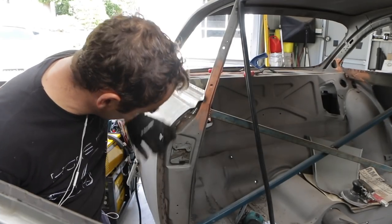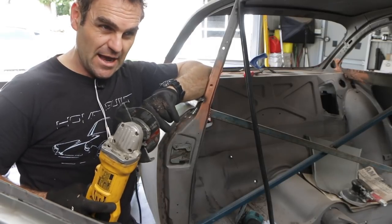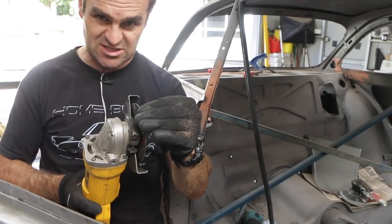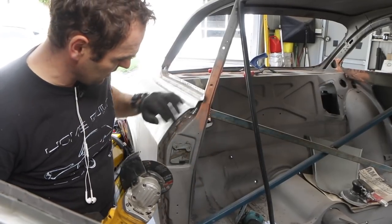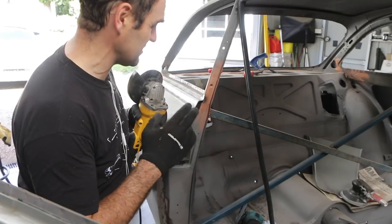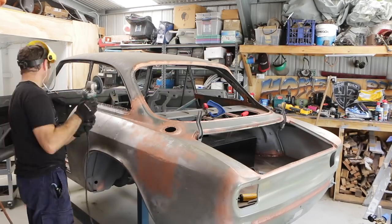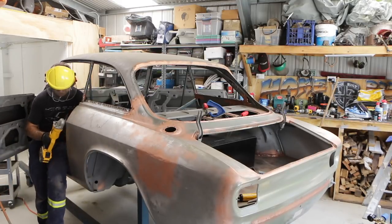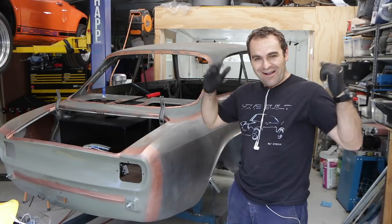That's all looking really nice. I went through and did most of the grinding with the cutting wheel — you have to be very delicate with it because it's flimsy and can break easily, so you're just using the tip and lightly scraping away. That works really well to get it nice and neat all the way along. I'll go around now, put a bit of weld-through primer on it for temporary cover, finish grinding back a couple more bits on the other side, and then the thing is on.